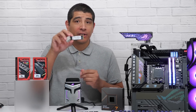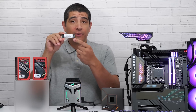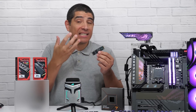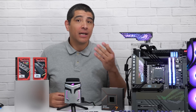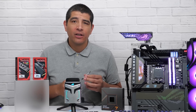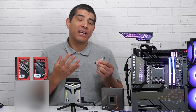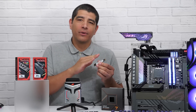What does dual-contact mean? When you look at an M.2 SSD, you'll find NAND chips on the front as well as on the back. As you increase the number of NAND chips to reach higher densities — one terabyte, two, four, eight terabytes and beyond — there will be NAND on both sides, meaning you want heat dissipation for both the front and the back.